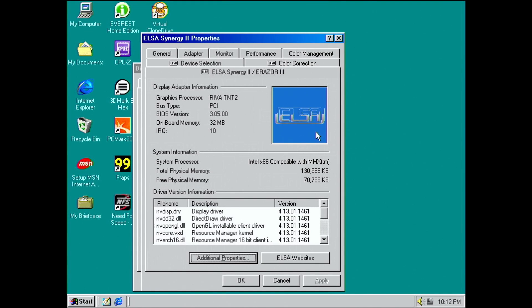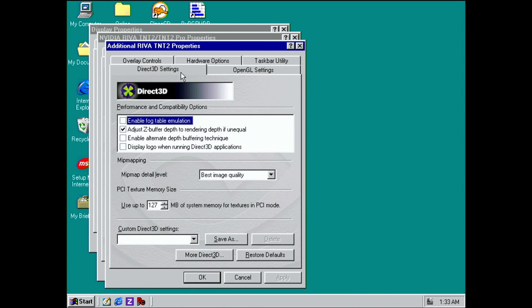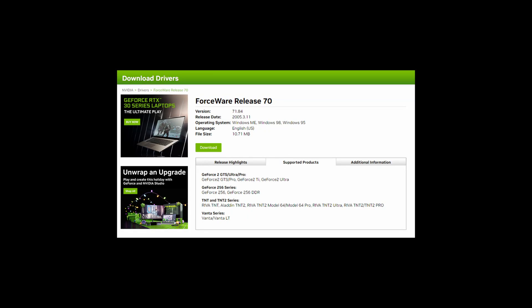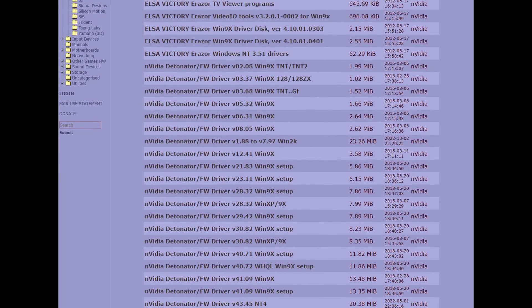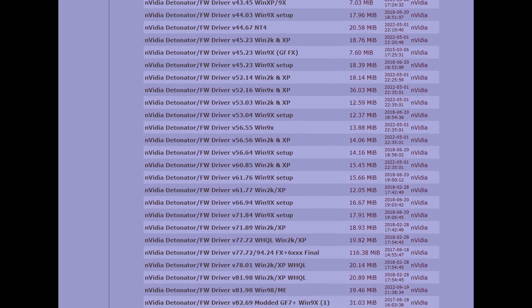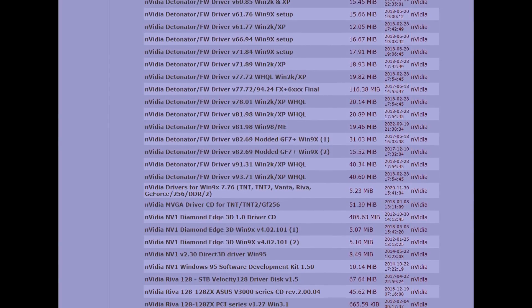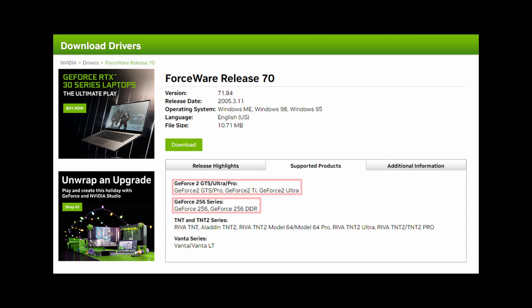The Synergy 2 is a professional graphics card with its own drivers provided by ELSA, but the card seems to be working fine with the reference drivers from Nvidia for their TNT and TNT2 graphics chips. The so-called Detonator drivers are no longer available on Nvidia's website unless you are looking for the latest version, but you can go to the Vogons vintage driver library to get an older version. The driver to pick is a science of its own, as you will see in this video. A good rule is to get a driver that was released around the same time the game you want to play was released — those drivers will have the most optimizations included. Future drivers will most likely focus on newer generations of graphics chips and will no longer optimize for the old ones.